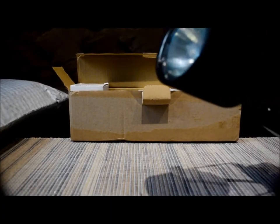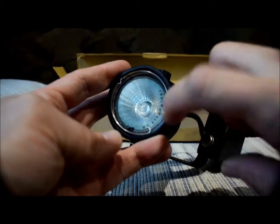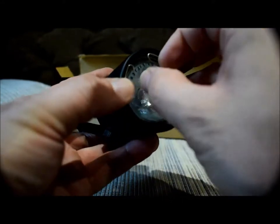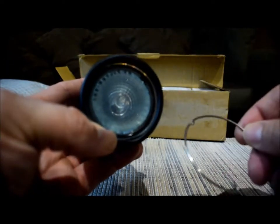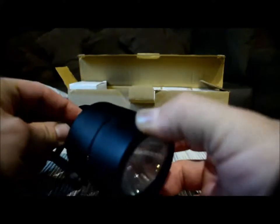Here's the old ballast — the old style. It's got the halogen bulb still inside. I'm going to remove the old bulb from the ballast. You take these two clips here and pinch them together to remove the retaining ring — watch out, it can shoot off across the room. There is a glass lens in there that has to come out as well.